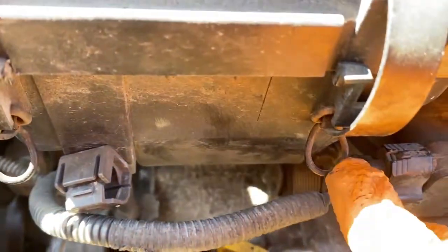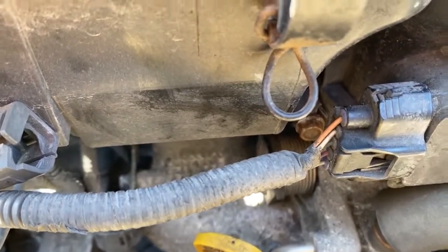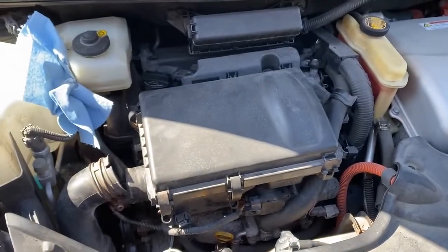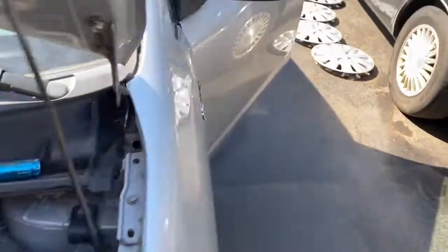You see this loop right down past it, so going underneath the loop between the wiring harness and the loop, that's on the hose clamp that holds the intake down. There should not be an air leak there, especially. There shouldn't be an air leak anywhere, but just a simple short extension and a 10mm socket gets to that guy pretty easy. So I'm gonna go back in here, put the car in maintenance mode.